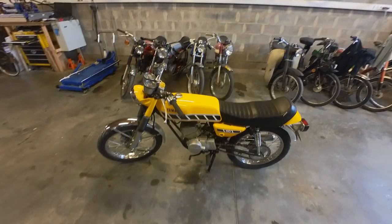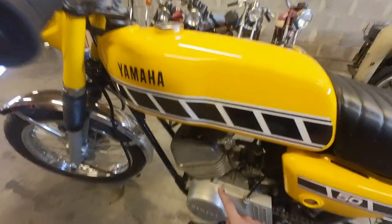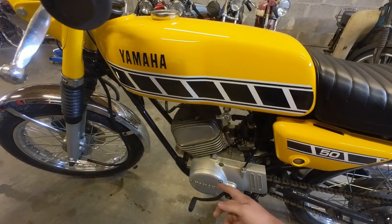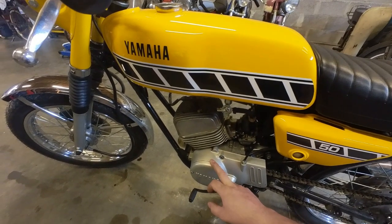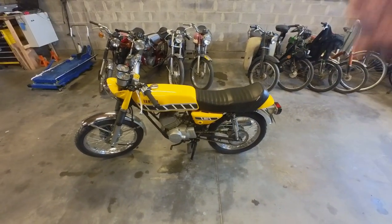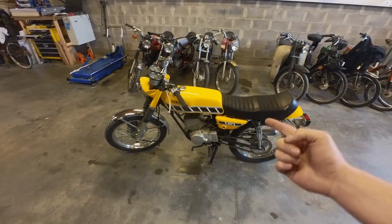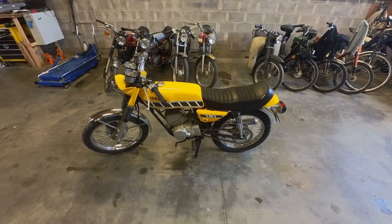That will be it for this install. One last thing I have to mention: I did put some washers in between the cover because they advise you to have some extra cooling on these ignitions. We might have to adapt a cover - maybe get an extra one and get some slots in it, or make a new one. But for now I think this will do. I will remove the cover and check the heat of the ignition system. It's really strange that I struggled to get it starting after first installing the CDI - now this thing starts on the first kick without any choke. If you put the choke on, this thing will not start. Strange, but if it works, it works.